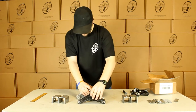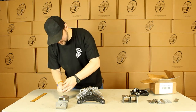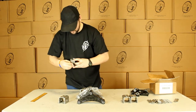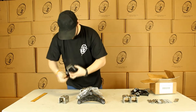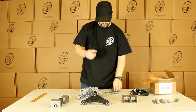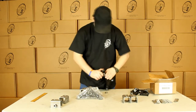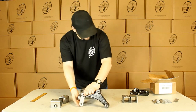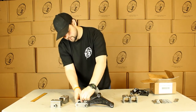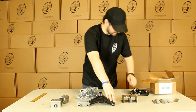When you're putting these together, these are going to go on the front — you'll weld them up like that. Your spring will sit right here. We'll slide your shackle bolt through and put your locking nut on. In the middle, you're going to slide the bolt through your shackle strap, slide it onto your equalizer, slide your other shackle strap on, put your bolt on, and then your spring is going to go through this side right here. Then you'll slide your shackle bolt in and bolt that all up. You're going to do the same for this side.